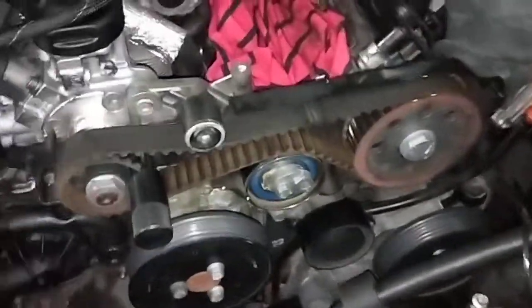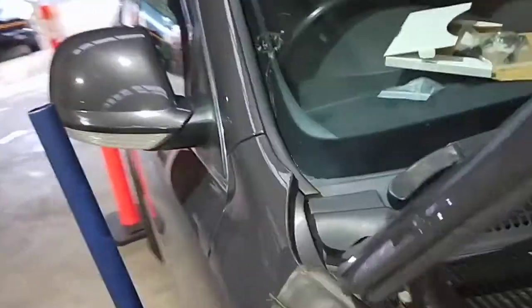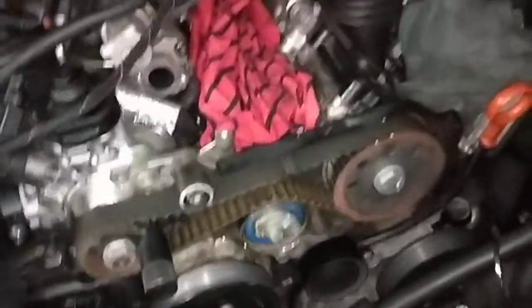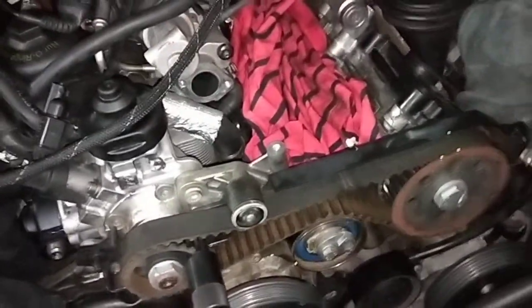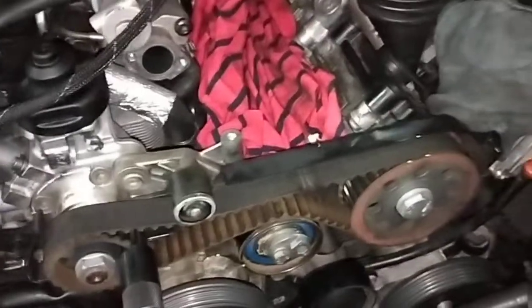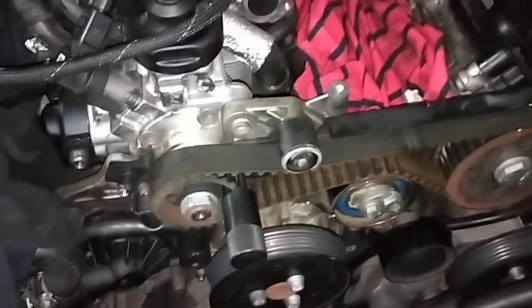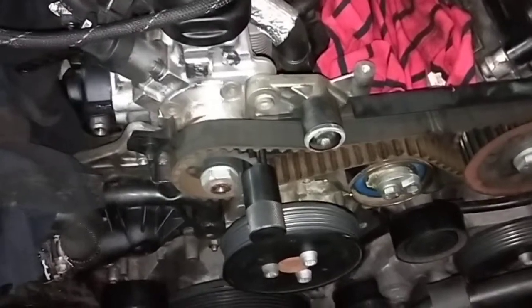All I'm going to do now is put a note here — a piece of paper saying 'Please do not start the engine. Remove crankshaft lock.' So what I usually do when I finish: I gather all the tools, make sure the tools are in the toolbox. Then before I start the car, I double check to make sure everything is off the crankshaft and all these tools are out. Obviously I take it out, but it's only a safety reason why I do it — because it's really easy to start the car up without taking the crankshaft tool out.